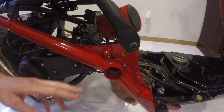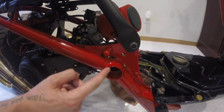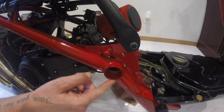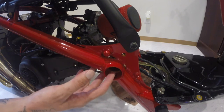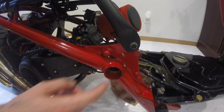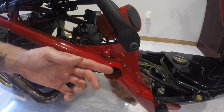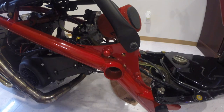This is where we're gonna be drilling right here. The first thing I'm gonna do is stick some tape around here just in case when I go at an angle I bump this and it starts scratching. I will be putting on some frame caps, but I still don't want to scratch it up. Best bet is obviously to do this before you powder coat, but it was kind of an afterthought and it's kind of my first build, so I'm still learning as I go along. I'm gonna use duct tape because it's thicker and allows more protection, and I have it readily available.